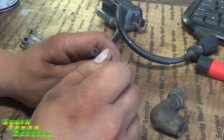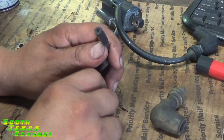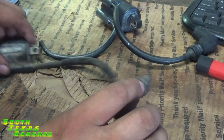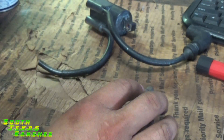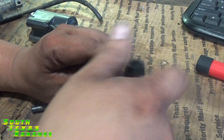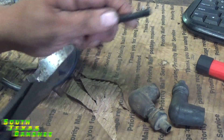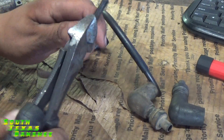It's just like a bad connection on a car — battery cables can be good and tight, you can't move them, but it still won't crank until you clean them and put them back on. Same deal here: the connection from arcing or getting loose just makes a bad connection. So what you do is take the plug cap off and trim off just a little bit of the wire — maybe a quarter inch, just like that.